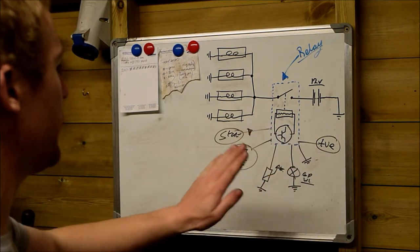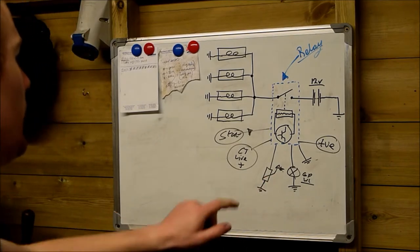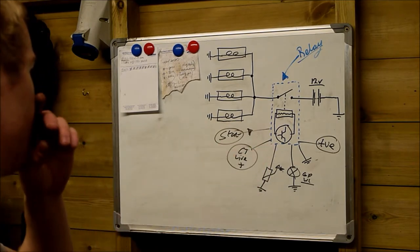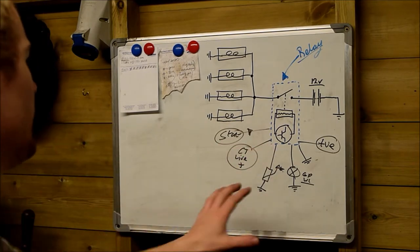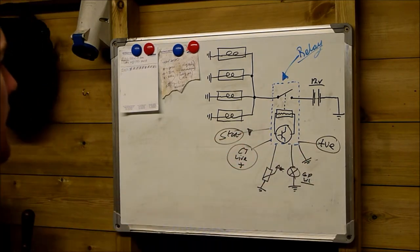If this glow plug relay only has 4 wires, you have the second type of glow plug relay, which I'll come on to in a minute. If it's got 6 or 7 or 8, I think there's 7 or 8 wires in it. Not too sure. If it has this system with multiple wires going into that multi-pin connector, then again you've got this type here.